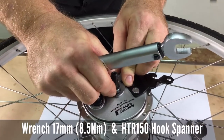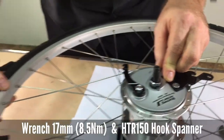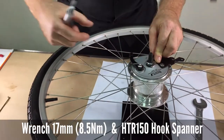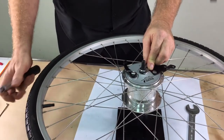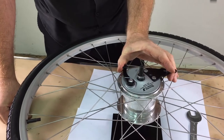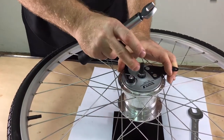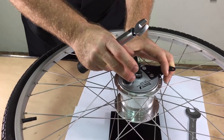The adjustment will need to be done with the bicycle wheel when you check the adjustment at the rim. Adjust it so it is just to the point of no play. However, before you adjust it, you want to compress the brake — this will center the brake arm and the brake pads in the drum.